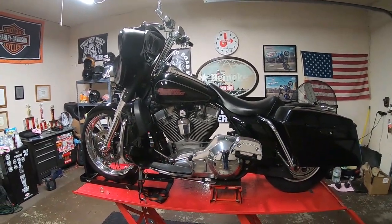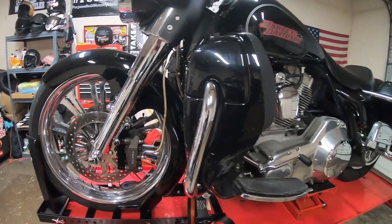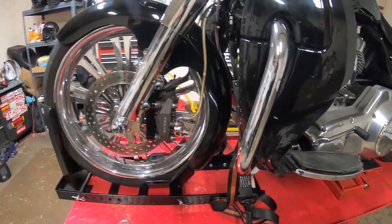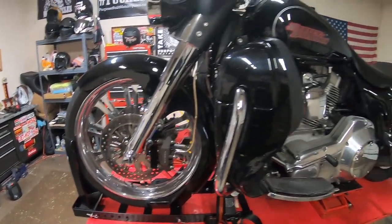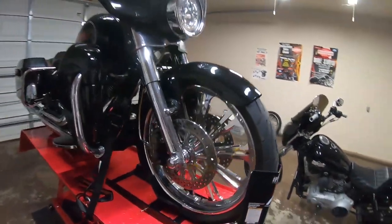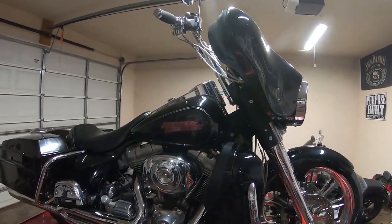And I wanted to show you something that works for me on these bikes. Hopefully it should work with these calipers. One thing I wanted to note is you never want to mix brake fluids together. So these were completely flushed out, and I'm just going to go back with the DOT 5 because that's what I have here. That's what's in the master, and we'll use that. I know multiple people that have run that DOT 5 with these and seem to have good luck. So let's get the bike lower down and we'll take this cap off and I'll show you what I do to bleed these.